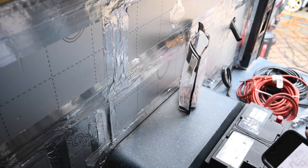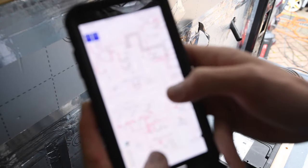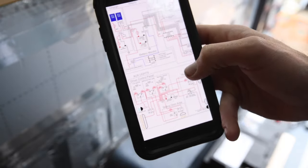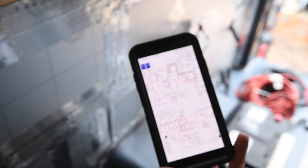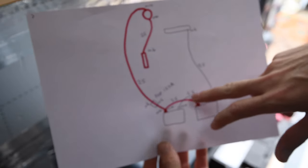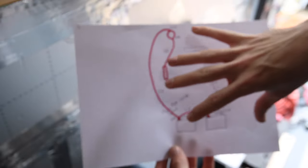It's really important to have an electrical system planned and laid out in your van build. I made an electrical diagram which shows the full plan — it looks quite complicated and I will be releasing it for people to have a look at. For the purpose of today I also made a simpler diagram showing the wire thicknesses I need, where the fuses are, and what size the lugs are. That's my wiring diagram for just this small part, then I can build on to the bigger one.